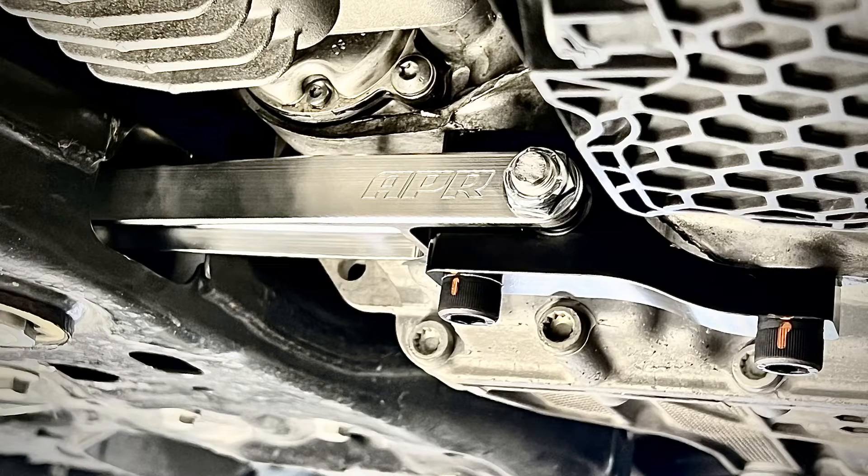This is what it looks like after the install — it's super clean looking, looks great. It's a pendulum mount. I've seen people twist their factory stamped steel one, and this will future-proof me as I put more power into the car. This is going to be a much more solid mount, and the ability to have reusable bolt hardware and a spherical bearing is really the benefit I was looking for. Anyway guys, that's it — just a quick video. Thanks for watching, and I'll catch you on the next one.